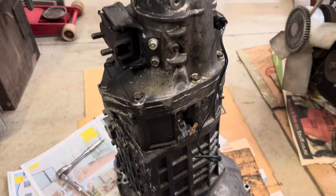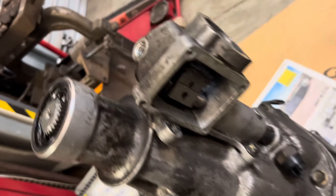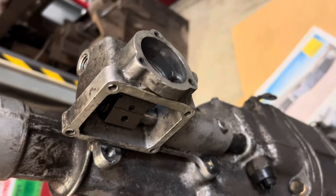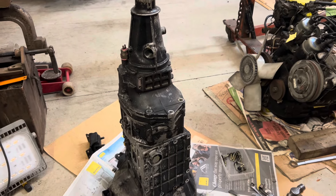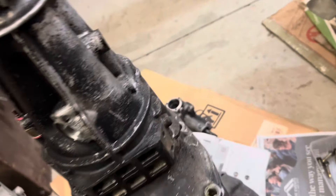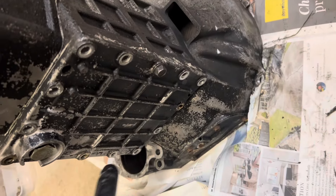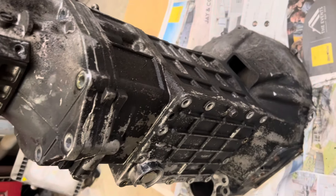So I've already pulled this cover here off, a couple of the fittings off over the side here. There's a little ball and spring and another little spring setup that kind of flicks back your gear lever. I've got that ready to separate, got these ready to undo. I've forgotten my tripod. These are all unbolted now, got the mount off, speedo drive out. I'll reseal that - if I can't get the O-ring I'll just put some seal around it. This is about ready to come off - not sure whether I'll separate these, I'll see how I go. I think I've got to warm up the casing to separate that.